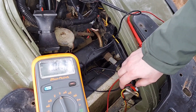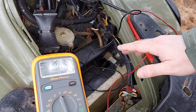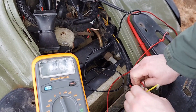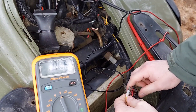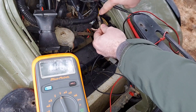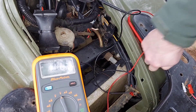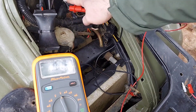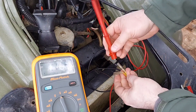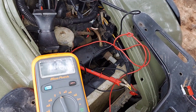You're going to need to unplug the yellow and the yellow-and-red wire — they might be slightly different on your machine depending on what year. Go ahead and unplug those. Also unplug the yellow-and-red wire in the same loom. Hook up your meter to a good ground — I use the ground at the coil where it mounts to the frame. Hook your meter up on the positive side.